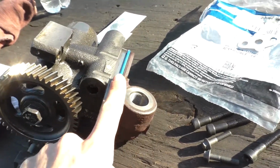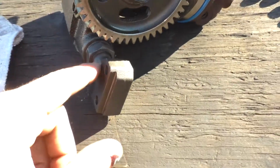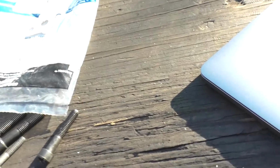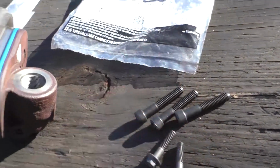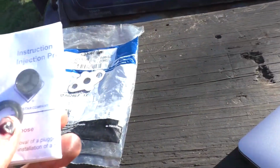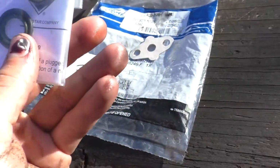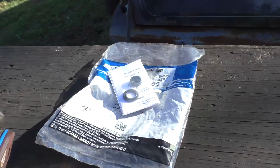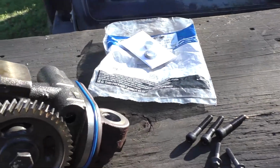So the main gasket for the H-POP housing, the new snap to connect fitting replacement. It comes with a gasket for the H-POP cover. Comes with new bolts for both the branch tube and the actual H-POP mounting bolts. Comes with those two O-rings I just mentioned, and it also comes with an IPR screen and seal replacement kit, all in that one package. And I think that one package was like $40. It's really worth doing.